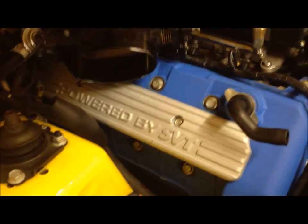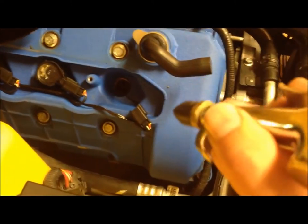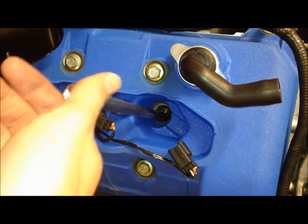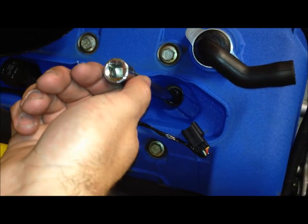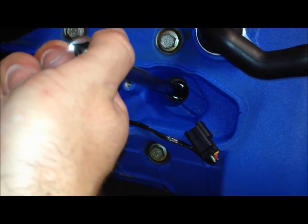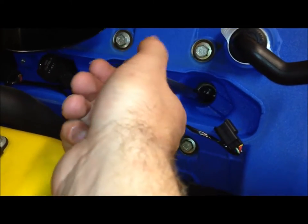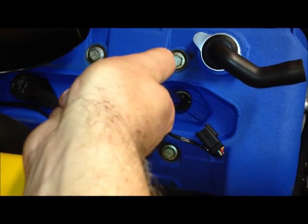Take out these 8 millimeter bolts, remove the coil cover, and start pulling plugs. I already came in here with the straw attached to blow out any debris, but it's actually pretty clean. I've threaded the new plug by hand after pulling the old one out. Remember to stay centered — not angled down or up — and keep it hand tight for now, going in very straight. Make sure you're not cross-threading it and do it by hand as much as you can. Don't be driving it in with a wrench right away.